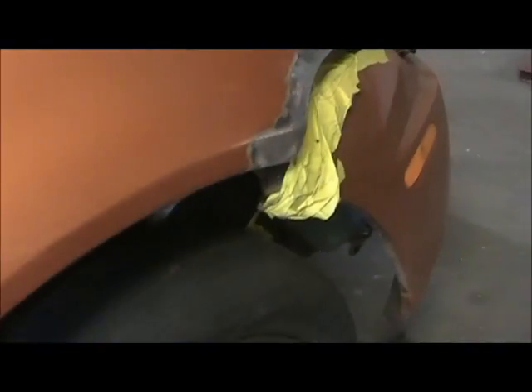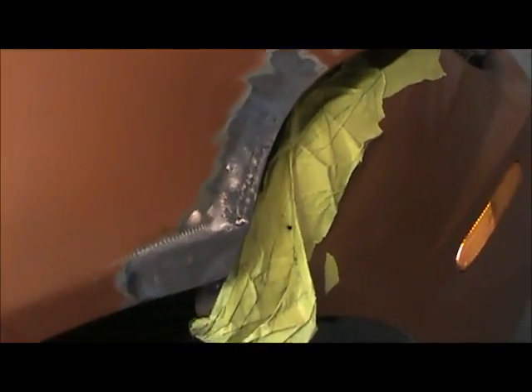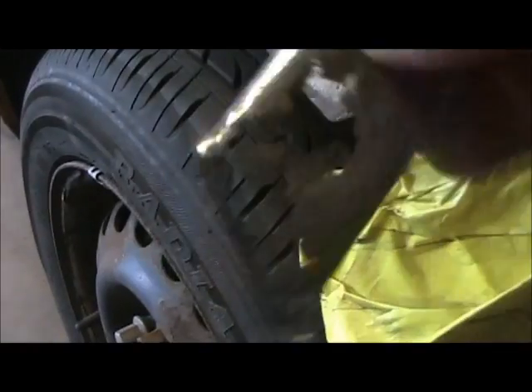He's kind of in a hurry for his car to get it inspected. This area up here was all blistered, but as soon as I hit it, it went right through. So I had to put that section in, this section, a little strip, and then the bottom part where the bumper hooks on. The bumper still fits and there won't be a lot of body work there because it didn't change shape much. This rocker here was the same — just fell off more or less. So I got it welded right along that ridge.